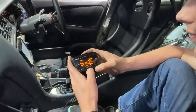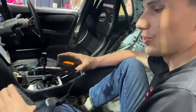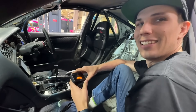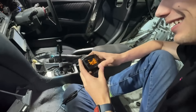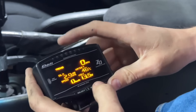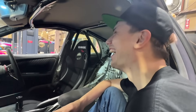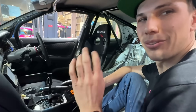Got your little Defi, a genuine ZD Advanced. I think everywhere else in the world there were tons of fakes of these made. But these are awesome because they still use all the Defi control modules and all the sensors, and instead of having like 50,000 gauges all on your dash — let's be honest though, 50,000 gauges is cool, it's a 90s vibe. Right now we've got oil pressure, water temp, voltage, and there'll also be boost here — so we're just going to change what you want to see on the screen at all times. Does it have to be in KPA? Yes, I think so. Celsius? Yes. Well, it looks like I'm learning. Can we just write some sticky notes on when to chill and when not to? We can also set the alarm digitally — oil temperature or water temperature — when you want it to go crazy. Sick.